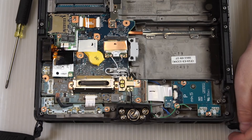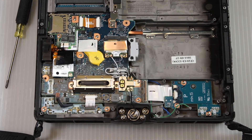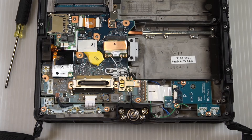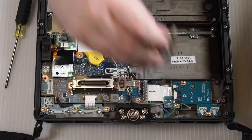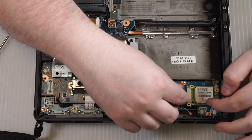The GPS board itself connects into the audio board. Just line up its position, then slide the ribbon cable in place and clip the wires.